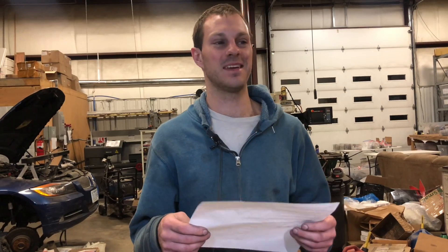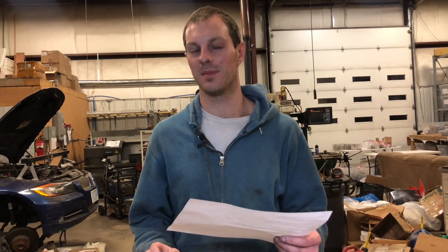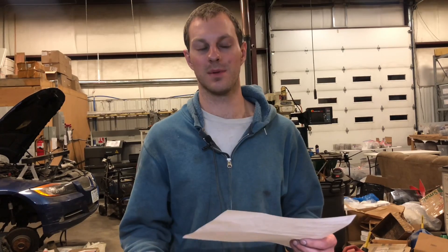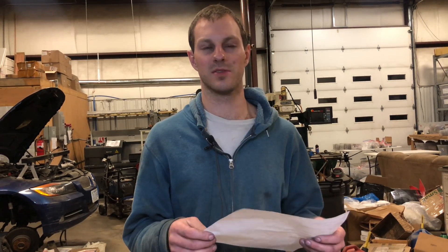You can also go with a smaller turbo. Some people get a little excessive when they put a big turbo on a small motor or small car because they think it means big power, but that's not always the case. A very large turbo may make big power but it's more of a dyno queen than anything else because it really reduces the drivability of the vehicle.